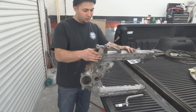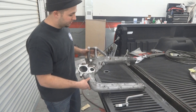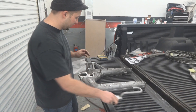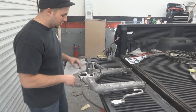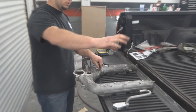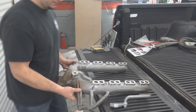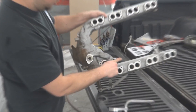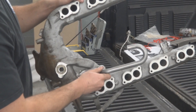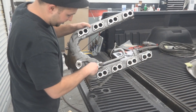We actually have a 6-liter intake here, and I'm going to show you guys where the EGR cooler is and how it mounts. The bypass we make is just the aluminum J-tube blue steel that we sell. The intake comes off here, the MAP sensor plugs up there, and you also have coolant holes running to the coolant reservoir. If we flip this over, you can see where the actual EGR cooler was mounted, and our bypass mounts in here and also connects to the exhaust.